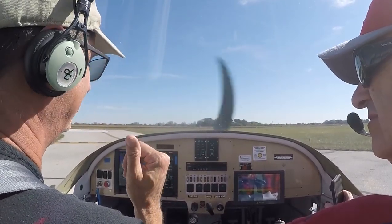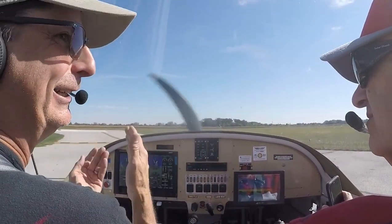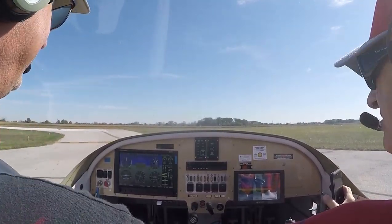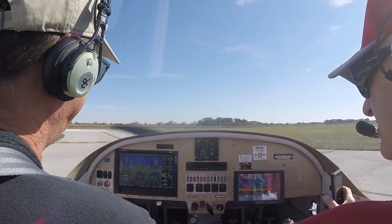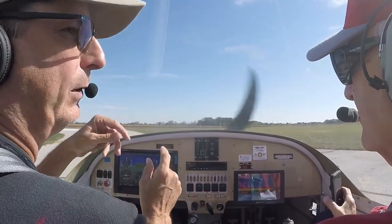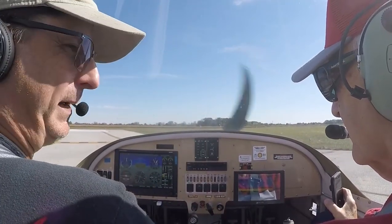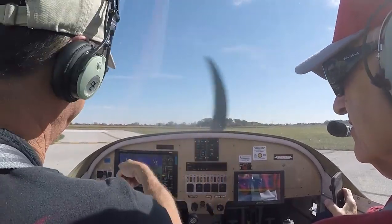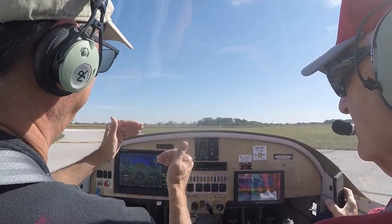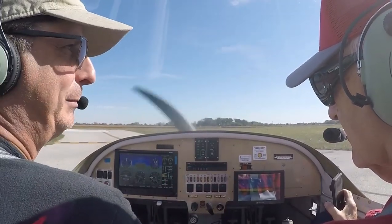The stabilator here is controlled by cables, and if somebody had it off, there's the potential those cables got crossed. So you take a look back there and make sure the tail's going up and down, rudder's going right and left. Now for the engine: we're going to take it up to 4,000 RPM. There are two magnetos — every cylinder has two spark plugs, one driven off each magneto. We're going to turn off one magneto, turning off four spark plugs, and we should see an RPM drop. You expect about 180 RPM drop, and they should both agree within 50 RPM.